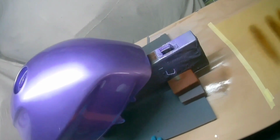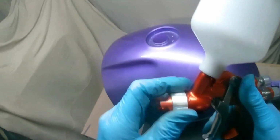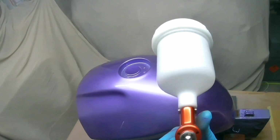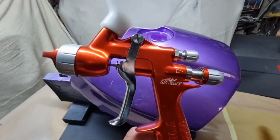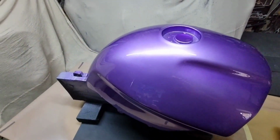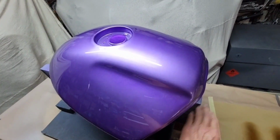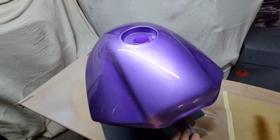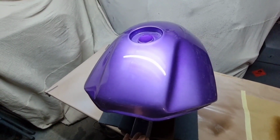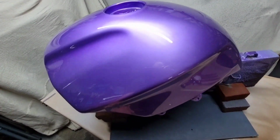But certainly, I've used 500 millilitres warmed up to 35 degrees Celsius at a temperature of about 26, 27, and it's perfectly usable for 2 full coats. That amount of fluid is basically all you're going to get in a pot anyway, isn't it? 500-600 millilitres. So yeah, I haven't found a problem with it, but it does help it to go off quicker, which helps cut down on runs, and helps cut down on nibs, because the quicker you can get the material to go off, the less chance of something landing in it or flying in it, and it being viscous enough for it to land in it and make an impression on it.